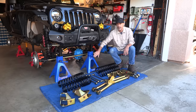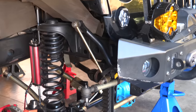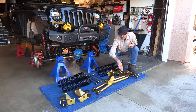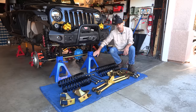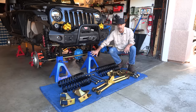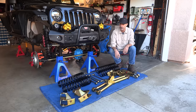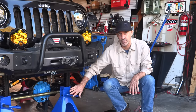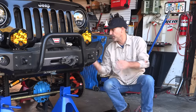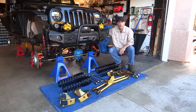But these right here, I got some 10 ton jack stands because you can't lift the frame from your normal spot. Where you're gonna be mounting these things and make room for your long arms kind of gets in the way of that. So I invested, these are $220 for these 10 ton jack stands, but it's because they go up high enough. You could probably find something. There's been a bit of drama trying to find jack stands lately since the whole recall thing at Harbor Freight. So I got some 10 ton jack stands. These things cost real money. That's kind of a heads up. You're gonna need to be creative on how you lift your Jeep and make sure that your Jeep is stable and up in the air and gives you the room.